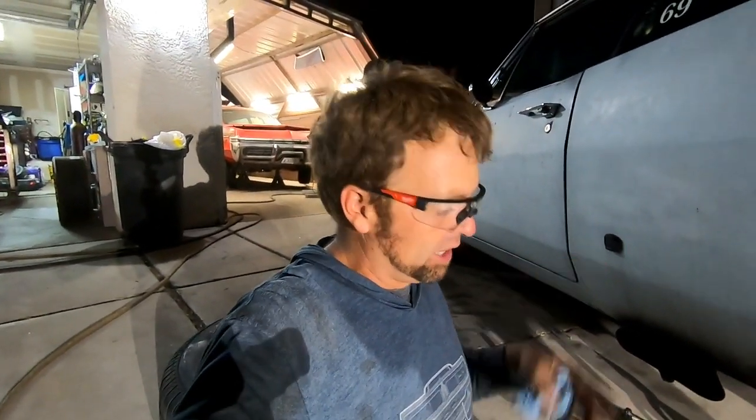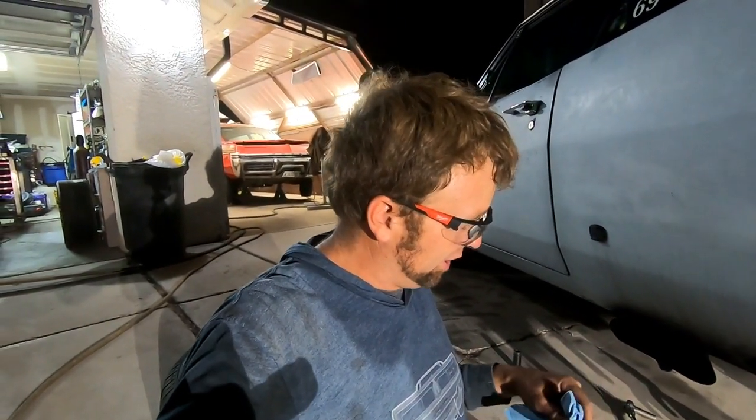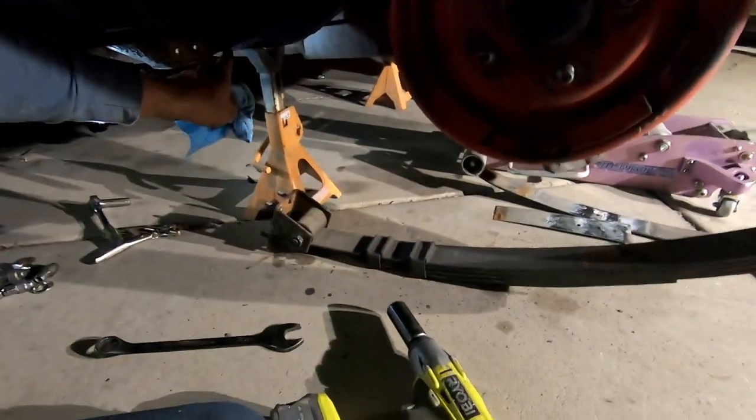I have no idea where it's at. I didn't check it. I should have. I can always fix it later if it's wrong. But the car did get pretty good before, and it didn't have any driveline vibration. So I'm going to say it was in the ballpark, and by lifting that front leaf spring, it's probably taken 2 degrees out of it. So I have a 2-degree shim to put it back in. Enough said. All right, so I'm going to go ahead and oblong those holes.